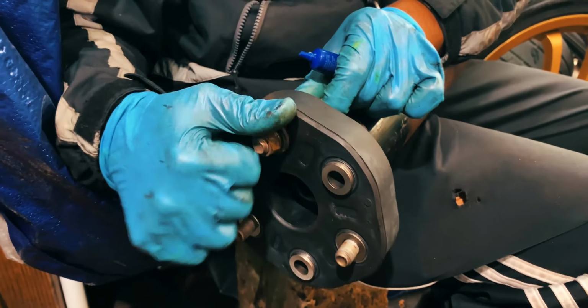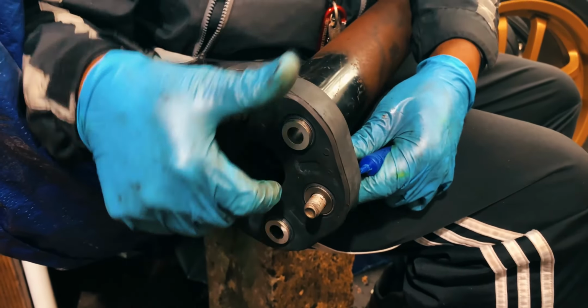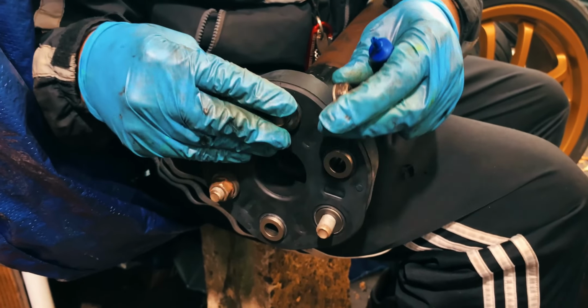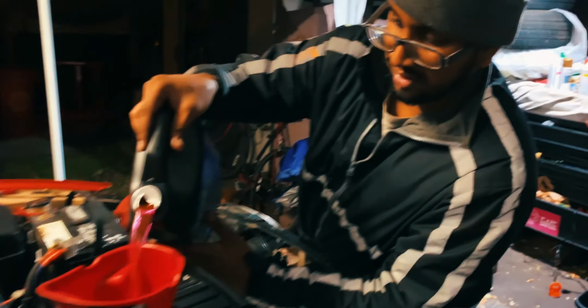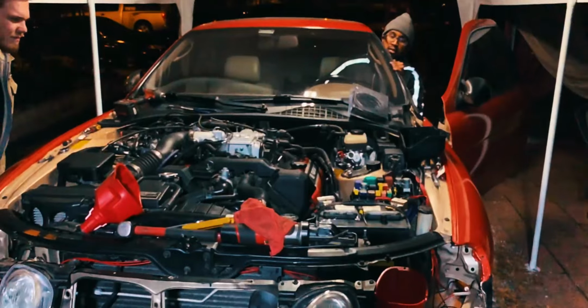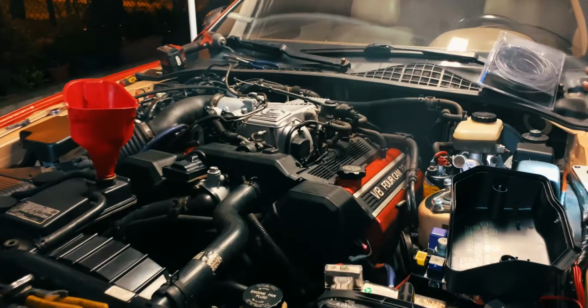With that done, we bolted the transmission crossmember in place and got the custom one-piece drive shaft ready. I purchased a new guibo from Japan for much less than what Lexus was charging, and the drive shaft was bolted back in. The next evening, it was time to start adding fluids back into the motor. On first startup, we checked for leaks and let the paint bake onto the headers for the first time.